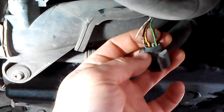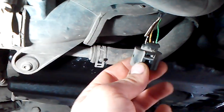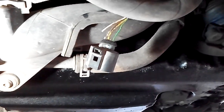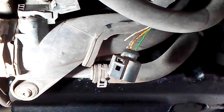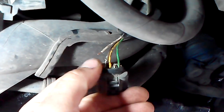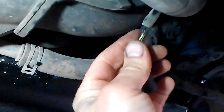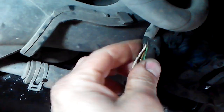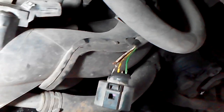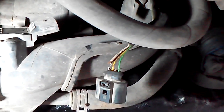I have removed the connector and you can see there is one obvious reason why the sensor is not working. It's usually from the shaking of the engine - it twists the cables. As you can notice, this is the second time it has twisted the wires. The first time it was this one, and I cut a little of the shielding because it had become brittle from age. Now we have another wire that has twisted out.